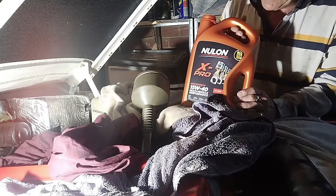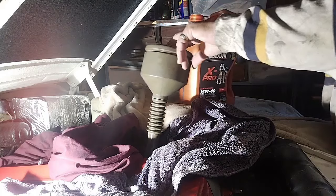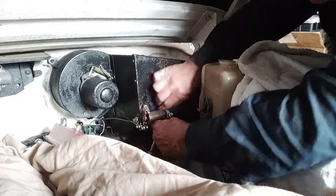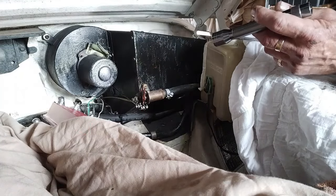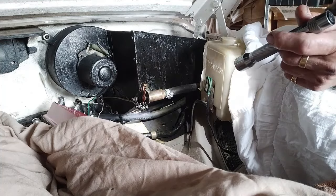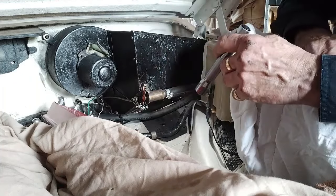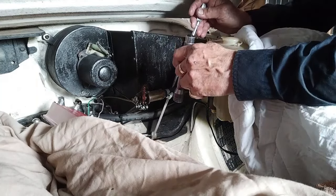What I try to do is put a lot of towels and sheets around when I fill the oil up, because it's just a horrible job and oil can go everywhere — and always does. Let's see what the dipstick's doing. The oil is all nice and clean now, so it's a bit hard to see on the dipstick, but it looks like it's just above maximum. The oil filter housing will probably hold something like half a litre, so when the engine starts up for the first time the filter casing will fill up and the level should drop back down to the correct level.